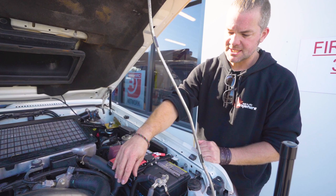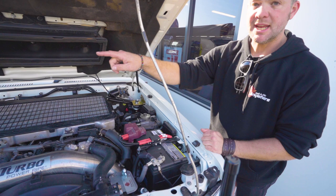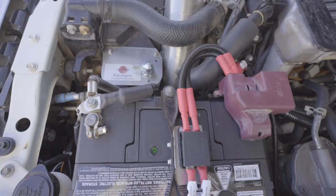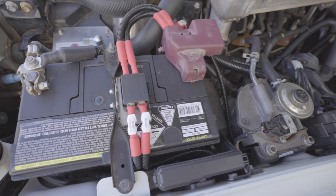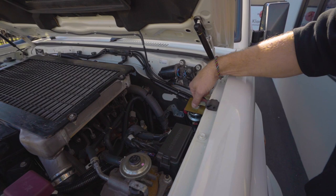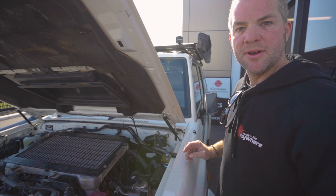And this bracket also works for a 300 amp ANL fuse in case the customer wants to upgrade the alternator in the future. Then the fuse for the new 250 amp Enduro alternator can go on there as well. We put our twin MIDI fuses on here for the rear Anderson plug and for the Manager 30, directly off battery positive. And we've run 00 B&S cable for the rear winch, which has got its pickup here. Then there's an isolator for the rear winch here, so you can turn battery positive to the rear winch off when you're not in an off-road situation.